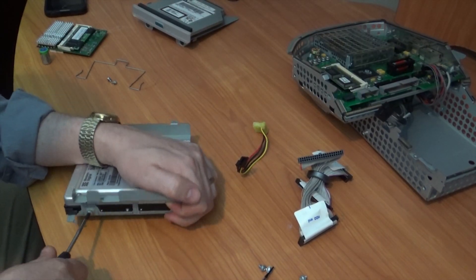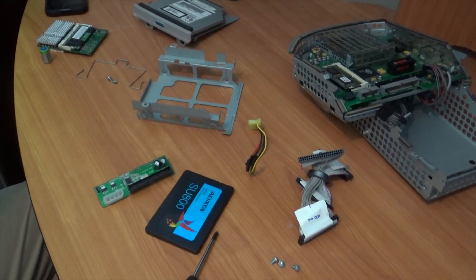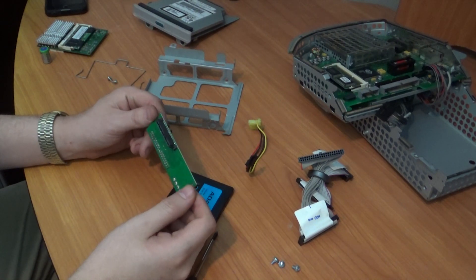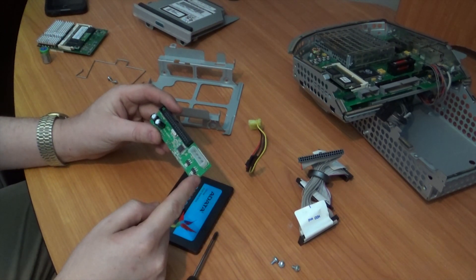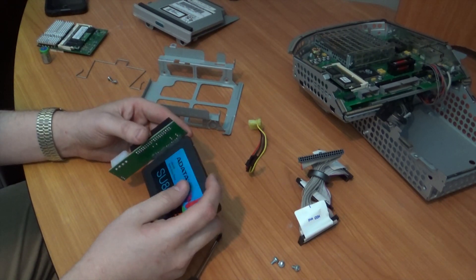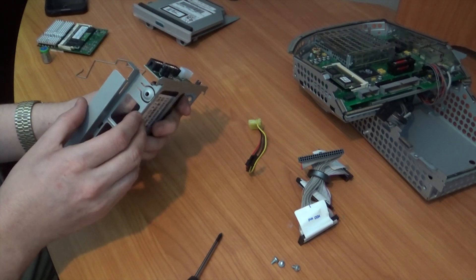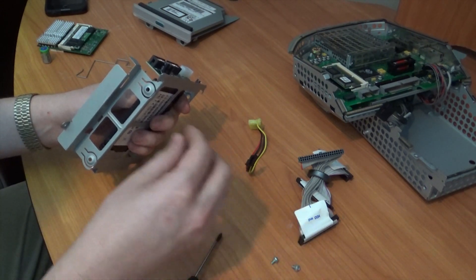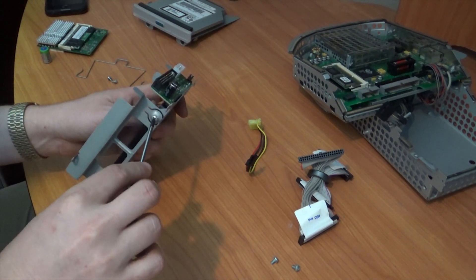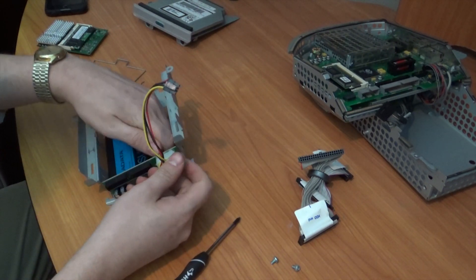It's a pretty standard setup with the way the hard drive is connected into the caddy — just four screws and the drive comes right out. When you're ready to install your solid state drive and adapter, verify the jumper setting matches what the drive was that you pulled out. Connect everything together, make sure it's snug, and put it into the caddy. I was only able to get one screw on to hold the whole assembly, so I augmented that with some electrical tape and also put some on the board itself to ensure nothing could short out.